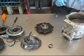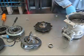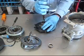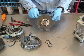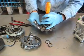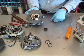There's a dust cover that pops out, and then we want to remove the snap ring. Snap ring pliers are not necessary — sometimes helpful, sometimes not. You can now see the seal is down in the center there. The easiest way to get it out is to drive it out. There is a puller tool to do that, but it's hard to find, so let's show you a way you can do at home. Get right behind the seal with a screwdriver, tap it out — there's your seal.